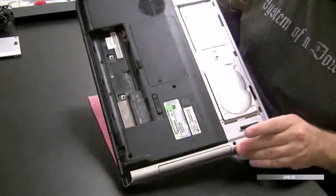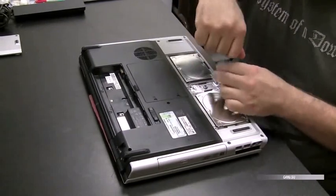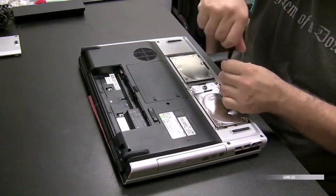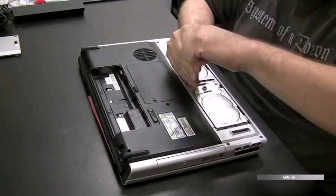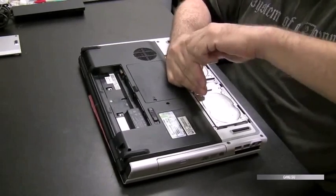And under that hard drive, you can see the white, that's from liquid, that's from water. So the water, or the iced tea, actually got down through the computer to the bottom of the hard drive. So it made it through the system. So I don't even turn the computer on until I check if the motherboard's okay.